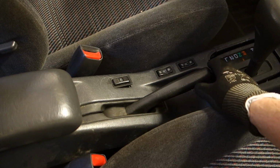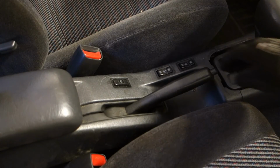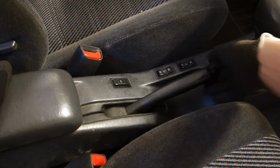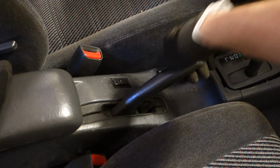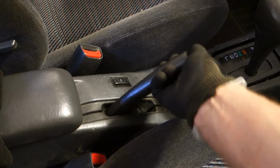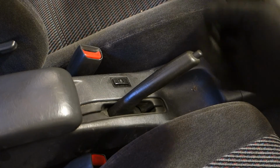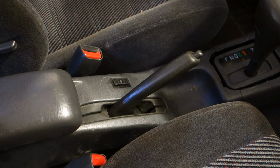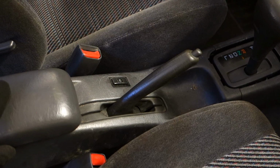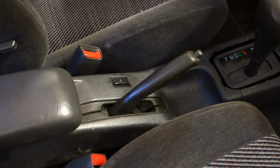Okay, and there is my handbrake cable, and I have now fastened that quite a lot, and now when I pull that up, something like 5 to 7 clicks is okay. 1, 2, 3, 4, 5, and now this is quite tight, and it is quite easy to pull up. And then we go to check, when I engage the handbrake now, how well those rear brake drums are tight, because now the handbrake is on and the brake drums must be on, and let's go to check.